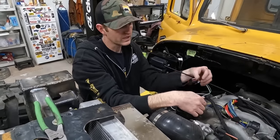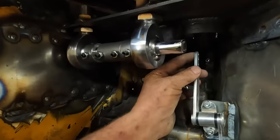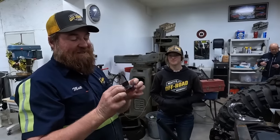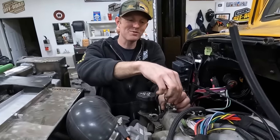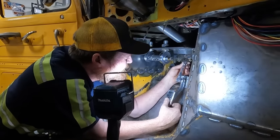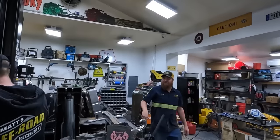I think that's backwards but it works. I'm looking at this and I think we got it lined up right — here's the arm that pulls the cable, there's where the cable comes out. I think we nailed it. This bracket is crazy sturdy — it's like a clutch cable bracket. Nobody wants a throttle bracket bending and losing throttle opening — it had to be solid. Pull it out a little, lock it. That's our setting — it winds up super good and it's solid.